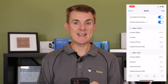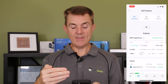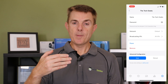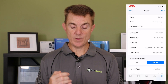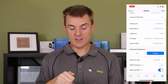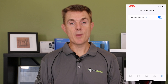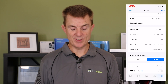Once we've got through those basics, you can see the WiFi experience — what applications are running through, how many users. We can go into WiFi to add a new WiFi or change the WiFi settings, and make the SSID appear on one access point or on others. We can also change our IP range by going into Gateway IP Subnet, turning off auto scale, and setting our IP addresses how we want them to be. The default should give you a good starting point.